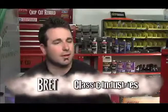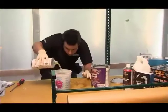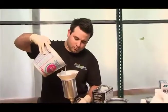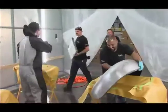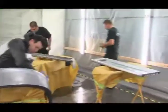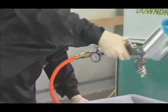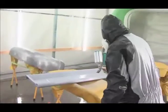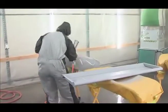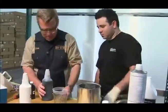My name is Brett Detlefson — I'm the graphic designer at Classic Industries by day and a custom painter by night. The products we used today were all House of Color products: direct metal epoxy primer, their catalyst made to mix with the epoxy primer, and reducer to thin it out. My preference when working with the paint is about 20 psi in the gun, keeping the gun about a foot away from the panels, with a nice even spray pattern and about a 50% overlap. 20 psi, 12 inches, 50% overlap — paint by numbers does have practical applications.